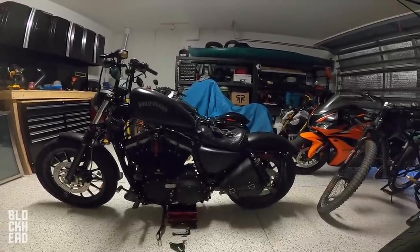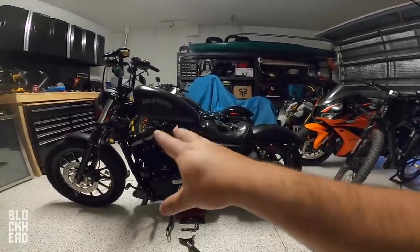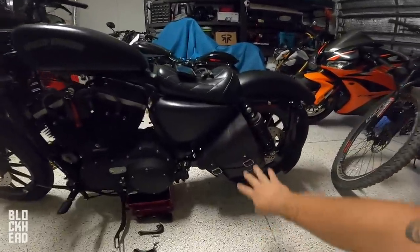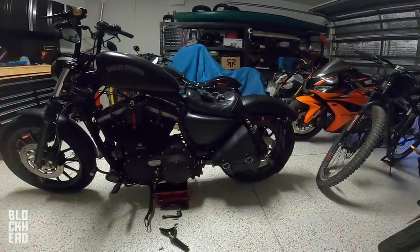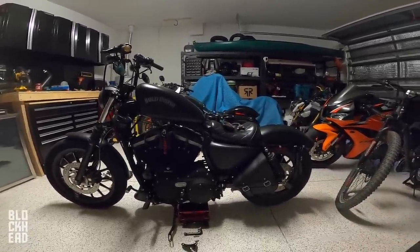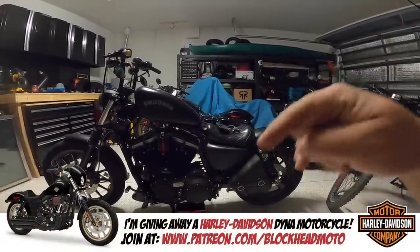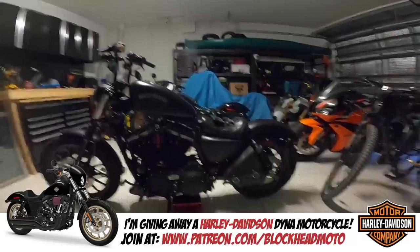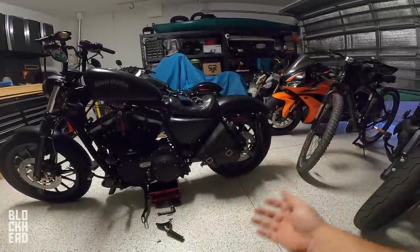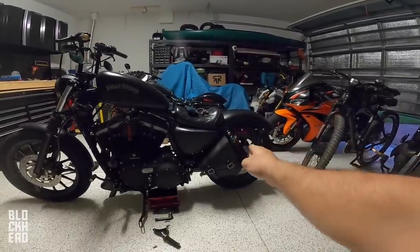That's a very requested video on the channel, so I hope you guys find that useful. If you're interested in the bag, be sure to check out the link down in the description below. I had one on this Sportster when I owned it initially for about a year and it didn't fade — if anything it just gets better as it breaks in because it actually softens up a bit. It's a great bag, doesn't have too much chrome on it, two buckles, nice and secure. The hardest thing about the install is where you route the leather straps. Loosely install all of them, then tighten that bottom right one down the most first so you have that line that follows the suspension, then tighten down the top one on the right, then tighten down the front one on the left. That'll pretty much set the bag in the position it's supposed to go, right within that little triangle on the Sportster frame.